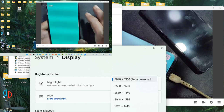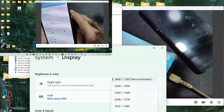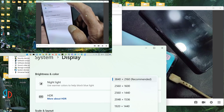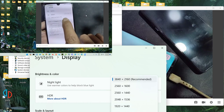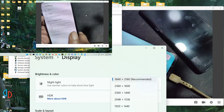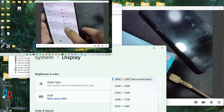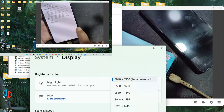Over here, open your Magisk app. Now we're going to patch the boot image. Okay. Next, select patch file, the boot image we just copied to your internal storage. Alright, go to your internal storage, V50S, boot image, select, let's go.